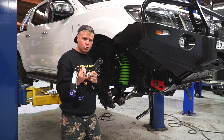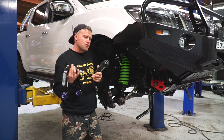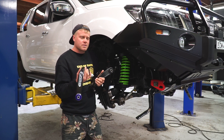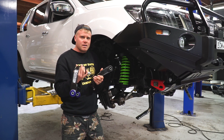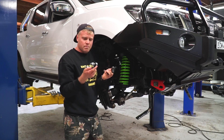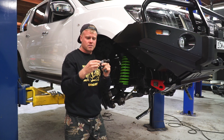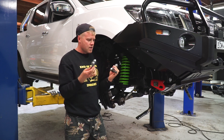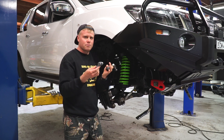The main thing is that they are adjustable. When you lift things back up, you can now adjust them and balance them back down. It's not as necessary with a two inch lift that we're doing today, but it is going to help — it's going to give you nicer steering and nice control in your car. It's going to make those wheel alignments a lot better. And then the other thing we're doing in the front is your adjustable front sway bar link pins — there's your old factory one, and these are your new ones. You can see they're adjustable, adjusted out a bit longer to counter for the lift, which is going to help with those wheel alignments and steering.